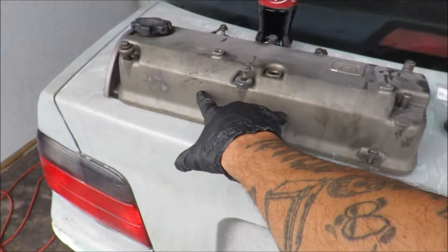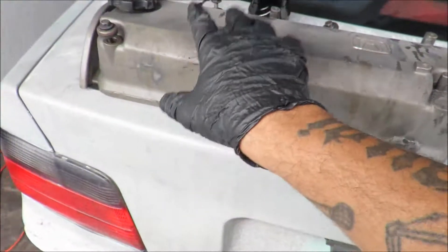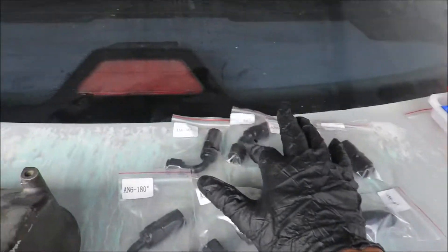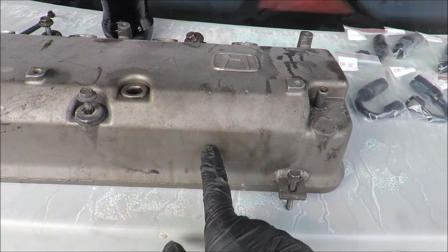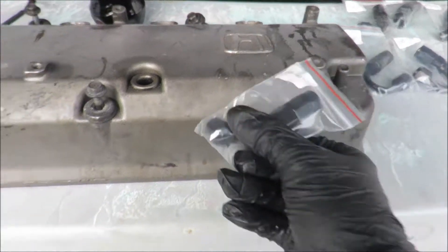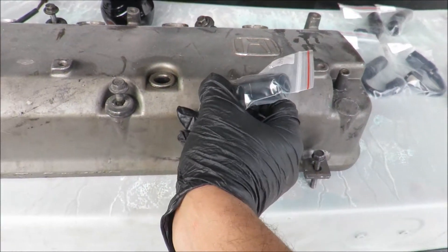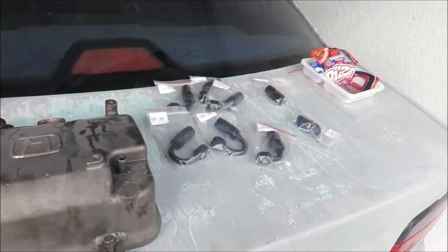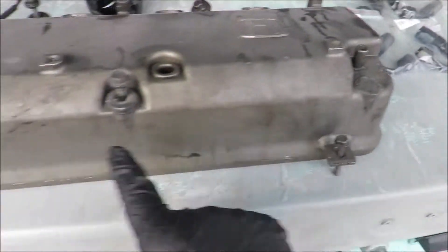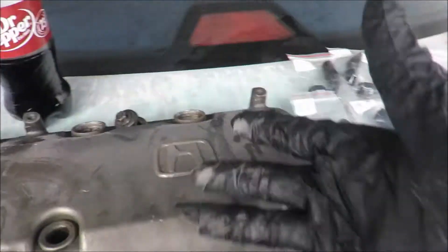What I'm gonna do is tap the valve cover on the Accord so I can get a catch can on there, because the old catch can didn't do anything. I really wanted to do one through the valve cover, so I got a bunch of these fittings. Only thing I forgot to get was the bungs to weld onto the valve cover. Debating if I want to go down here or up here and mine these out or something like that, maybe a 45. I'm gonna go look around for those bungs.